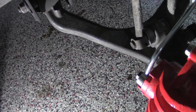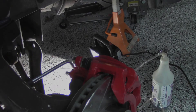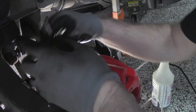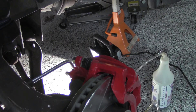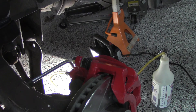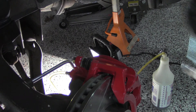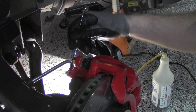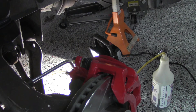Let's go to the left front wheel and that should finish it up. The last wheel — we've just installed the speed bleeder, we just need to back it off. We've already attached the tubing. Now you can see we've got good clear fluid coming out through this port. So we're going to close it up, refill the reservoir, and we're done.